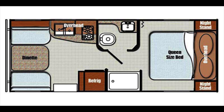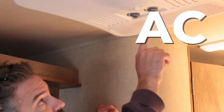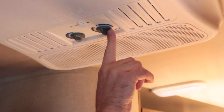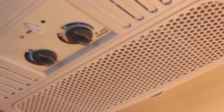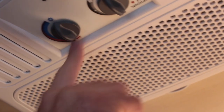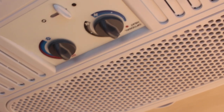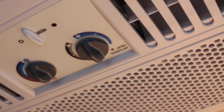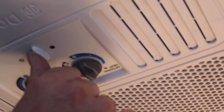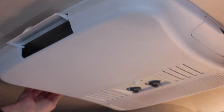This unit also has an overhead air conditioning unit. It will function when the trailer is plugged into 110. The fan speed dial is on the right — turning it into the blue section activates air conditioning, and the black section is just the fan blowing air. The dial on the left controls temperature, going from cold to hot. There's also a lever to recirculate the air, opening valves to push air back into itself. You can also direct air to the front or back of the trailer using doors that click open, and you can blow air to the sides as well.